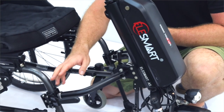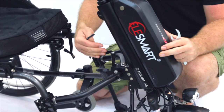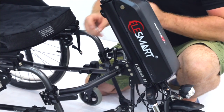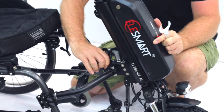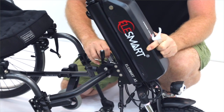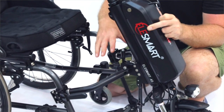So now that we've adjusted our clamps and tightened them down with our wrench, we also want to check that these two screws are tightened down and that our attachment arms are symmetrical. So we take our M6 Allen wrench, bring it here, and give it a snug tight. Ensuring all of these joints are tight, we can reduce movement when we accelerate or brake.